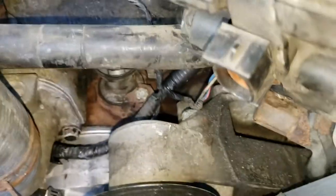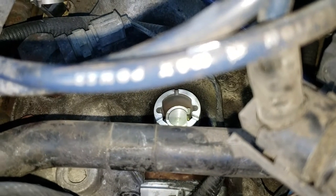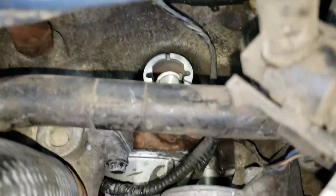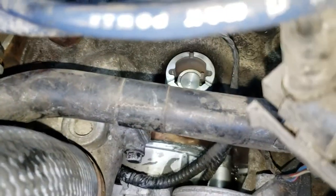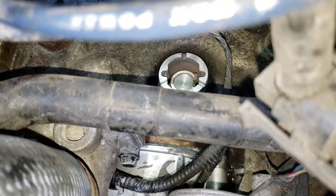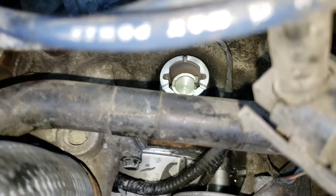I wonder if we can continue using the same sensor and just put the... You probably could, but since ours is a whole assembly, we're going to change it. Yeah, but we don't have to then worry about anything going wrong, which is the other concern that I might have. All right, but the problem is that for as many miles as on it, it has internal wear. So you're going to have a gear mechanism that has wear with a new sensor that does not. That sounds an awful lot like you're expecting this truck to last longer than it is.